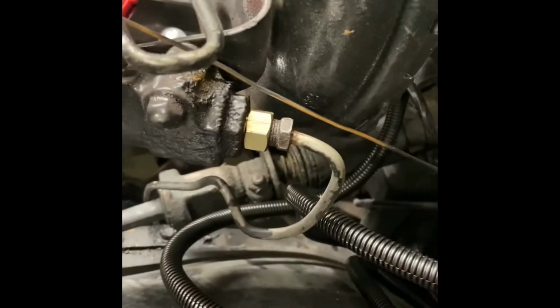Should be just great. So on the master cylinder and the booster here, I went ahead and bought a used one off of a guy. You can probably go to the junkyard and grab one, but I grabbed one off of a 71, 72 C10. And it didn't work out too bad. I'm trying to use the existing brake lines for now. And there's definitely got to be a conversion there. The brake lines going into the proportional valve are different than the proportional valve I had. So I'll go ahead and show you what size those were. There's the second one.